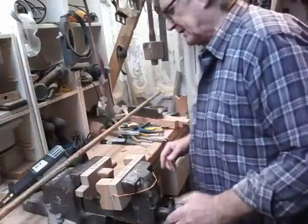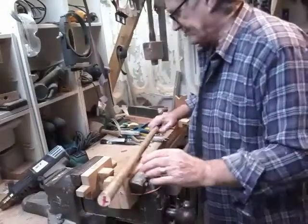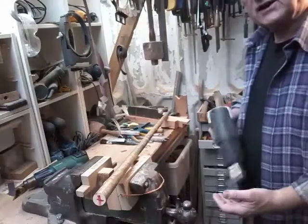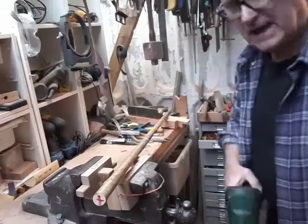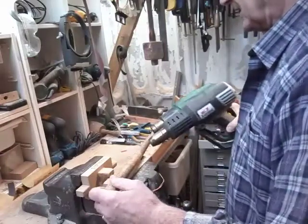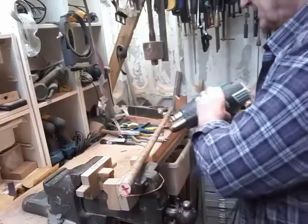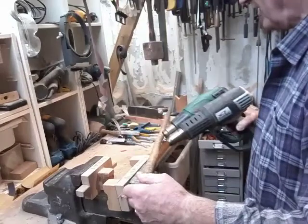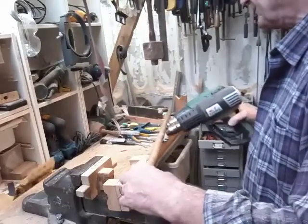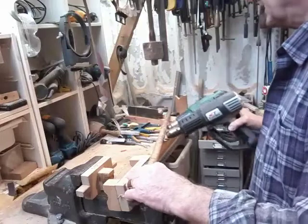I should really have an elastic band on that one — it's broken and I haven't got around to getting another one, so I just put up with it. Okay. Just get your hot air gun up to speed, and if you're impatient like me you can use two — one in each hand — and run along the shank where you want to put your heat. Keep it about an inch to an inch and a half away from the shank.